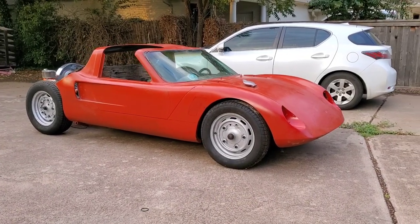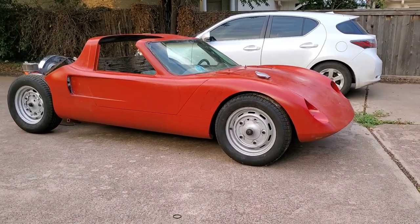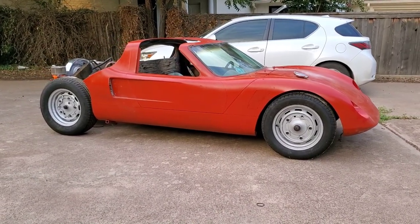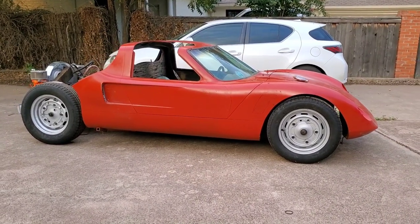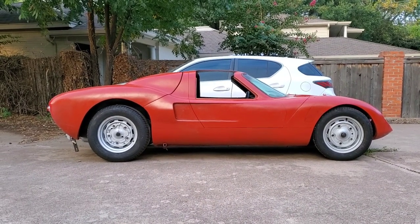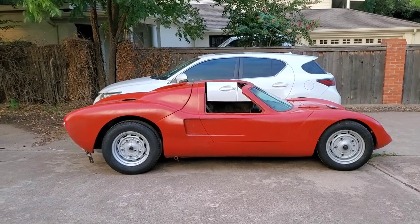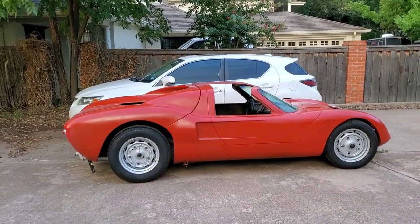This one uses a 1963 Beetle chassis. Now a stock Beetle with a steel body weighs about 1,600 pounds. This one is a lot lighter — I'm guessing around 1,200 pounds — so it doesn't take a lot of horsepower to get it going. In 1963, the Beetle came with a whopping 40 horsepower 1,200 CC motor. This one has a really nice built 1835 CC motor, which is probably putting out around 85 to 95 horsepower.